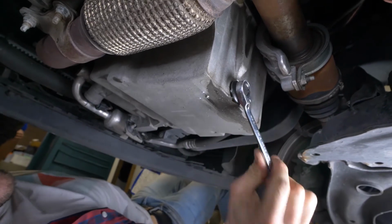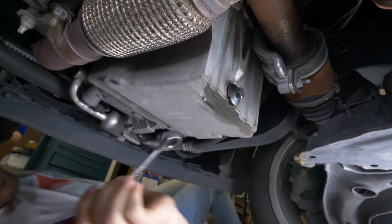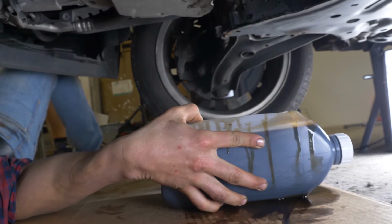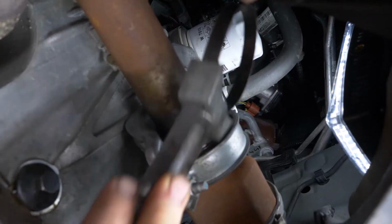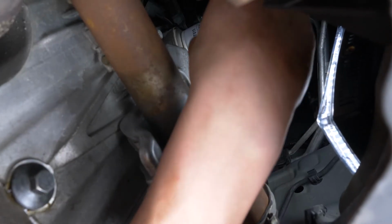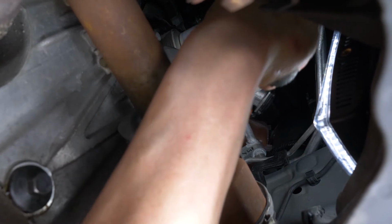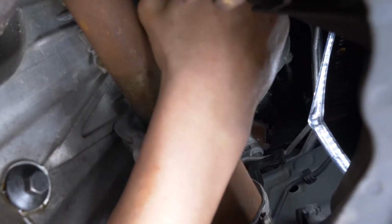When performing an oil change, it is necessary to replace the oil filter. Access to the oil filter is done from underneath the engine compartment. To avoid letting the oil inside the filter flow out, place a collector for liquids under it. Loosen the oil filter. If you're unable to do this by hand, you can release it with an oil filter wrench. If the filter remains stuck, watch our video unscrewing a blocked oil filter.